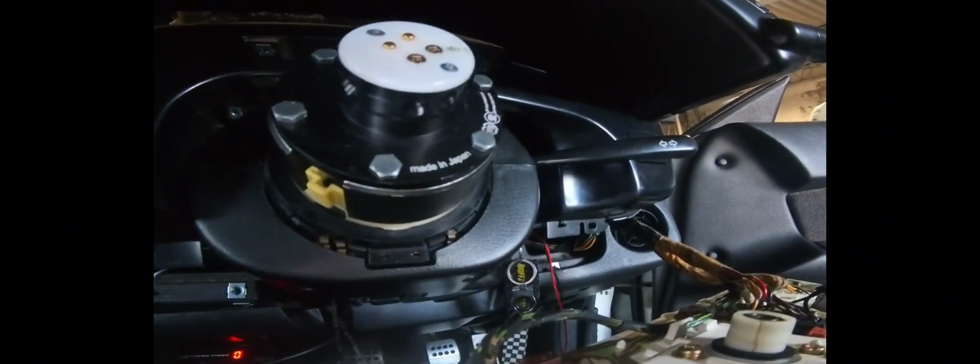Okay, so we found the left turn signal here. We just basically followed the trace and it led us to this connector. And so I'm going to assume, by looking at the trace here, that this is going to be the right one. Okay, so now that's done. Looking at this, it looks like it applies power for a second, and that's what causes it to flash. So on this connector, green-yellow and green-black provide the turn signal power.